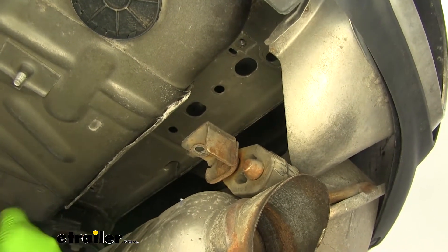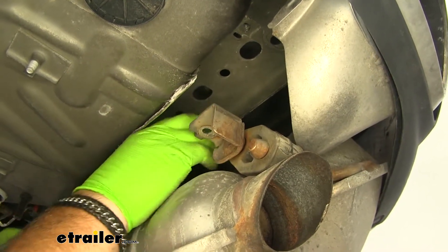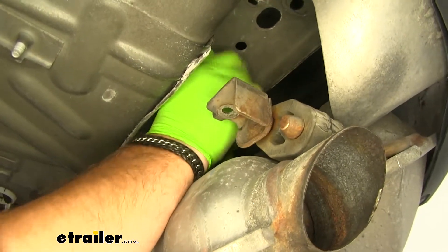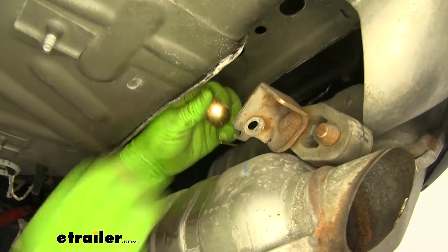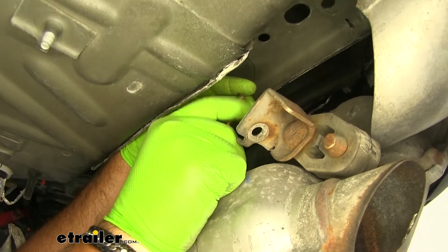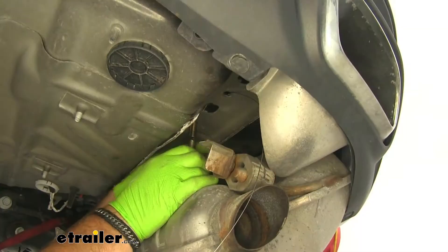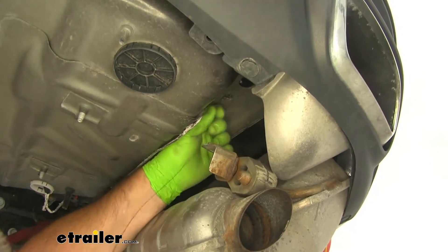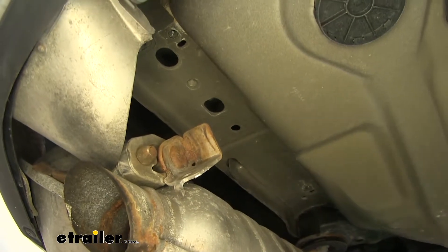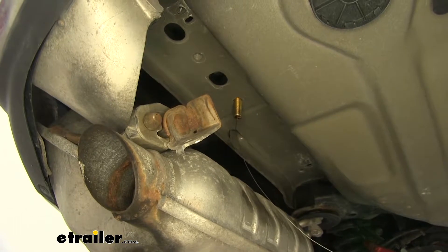To get our hardware in, we're going to take our pull wire and go through the hole we want to come out of — coming out of this big hole. We're going to put on the spacer block and feed it up into the hole. Then we take the carriage bolt, thread it on to the spring end of the wire, and feed it up into the hole, then pull it down just like that. We're going to do that same thing with the other one. On our driver side, as I mentioned, we're going to be pulling our bolt down through the front one and threading the bolt up into the other one. We'll do the same pull wire technique on that side and pull it down just like that.